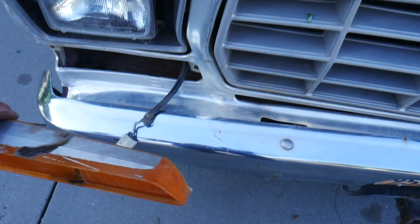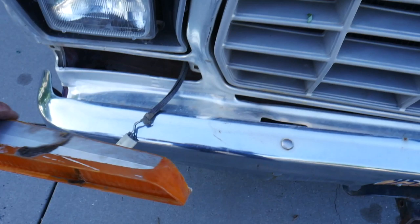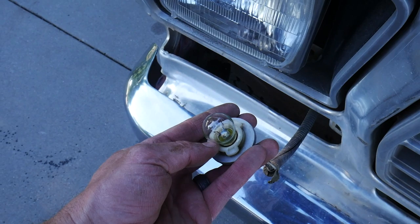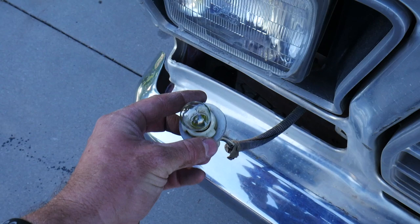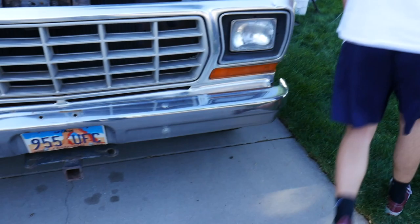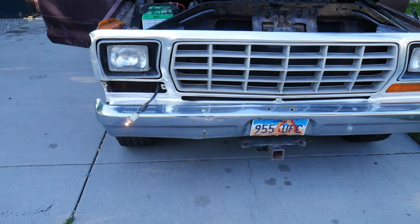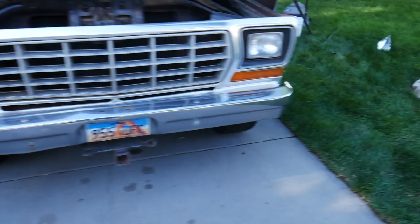So a real quick update — we took the turn signal apart and when we pulled it out, it's missing the entire back half where the bulb mounts. Behind the backing of it was corroded real bad. We finally got that cleaned up enough that it makes good contact. We took that one apart as well — cleaned it, put it back together. That one was actually working but it was dim. Go ahead and turn the lights on again, do the turn signals. There's one turn signal — now the other way — and we have a flashing bulb there too. So this is now working. Let's go show you what's happening at the back.